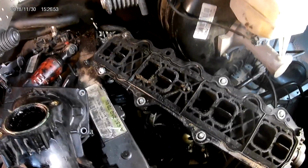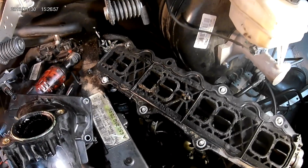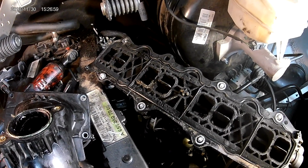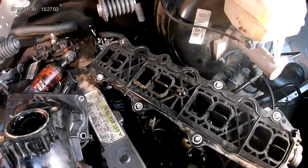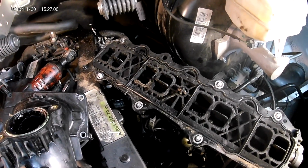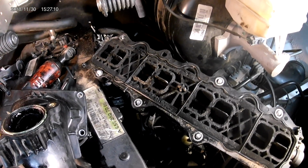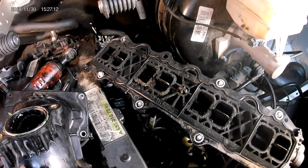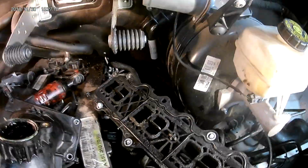But before we jump to all that, like I said, I can't stress enough, do your diagnostics. Take the time. Figure out whether it's a vacuum issue or a leak in your CAC, in your intake. Take the time to do that. I can't stress that enough. I get so many people ask, oh, well, how do you fix this? Well, did you do this? Well, no. Well, you need to do that before you go replace some parts. But anyhow, that's another story for another day.